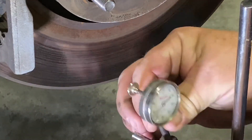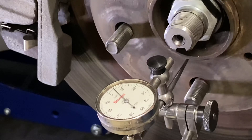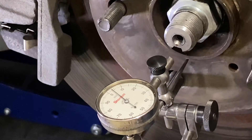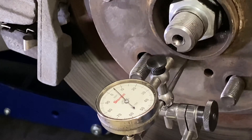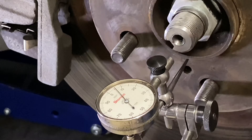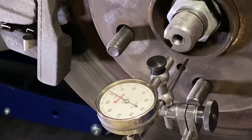So next, we'll set up a special indicator — I call it a teeter-totter indicator — and it allows me to put a needle inside or outside of the hub pilot, which really does serve to center the wheel. This is a pretty critical measurement here, given the sensation I'm feeling. I'm feeling a radial up-and-down vibration, so this is how you check that.